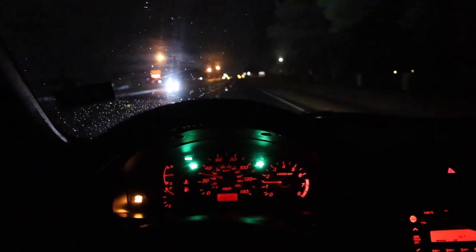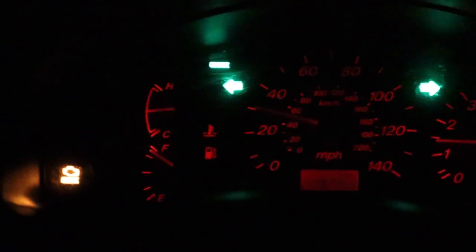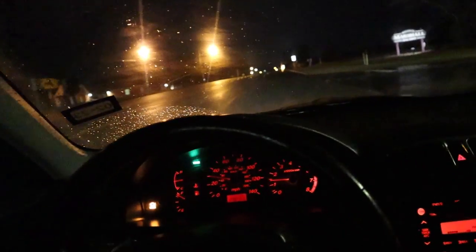Now we are on one of these main roads doing 30 miles an hour in fifth gear. This feels wrong on many levels, but as long as I keep it below 1500, I can still use cruise control, it's nice. But yeah, this feels wrong. Man, I'm telling you, for a problem, my luck is pretty good considering the car still drives. I limped it here and got an O2 sensor and camshaft position sensor code, and they had both those parts in stock.